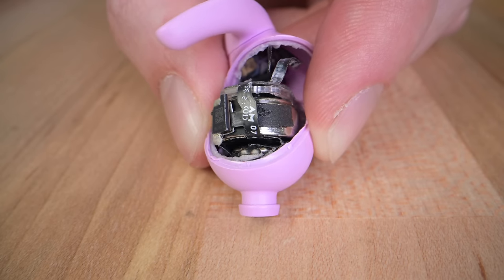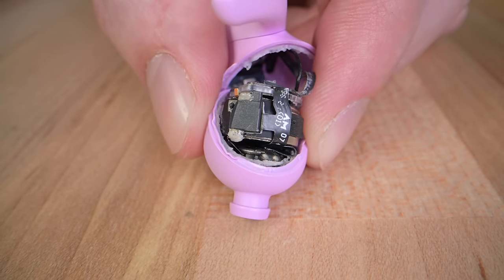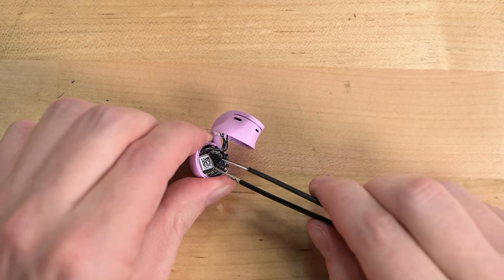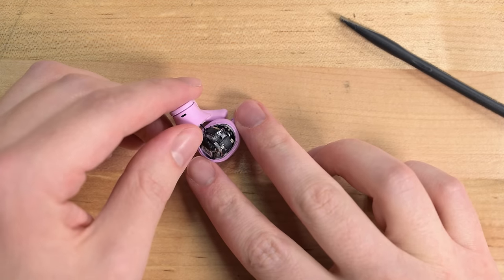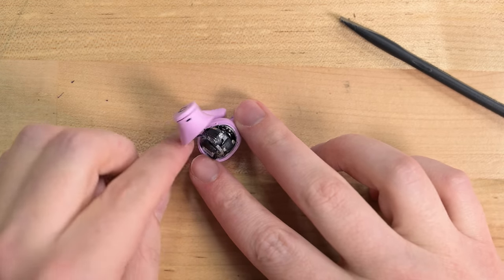Inside, it's organized chaos. There's a giant battery sandwich in one half and two fragile cables trailing off to the other. There's not really a clean way to separate any of this, so I'm going to go straight for the battery sandwich. It's unfortunately a booby trap situation — the flex cable connecting the circuit board to the battery will break if I pry under the battery, but I can't remove the circuit board because the clear plastic bracket under it is bonded to the plastic shell.